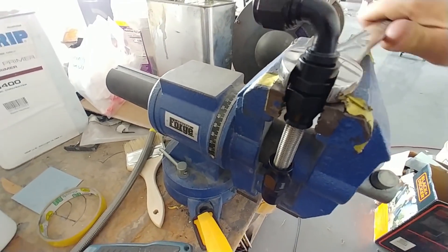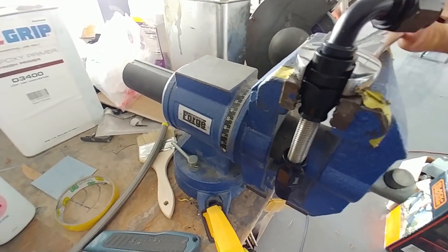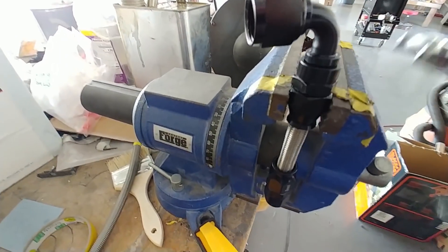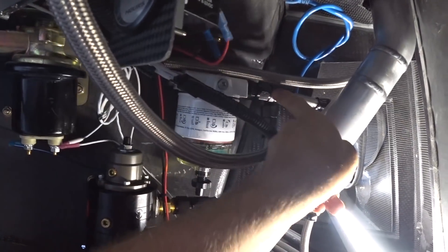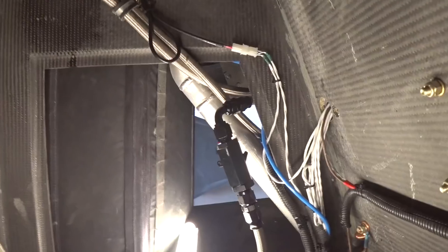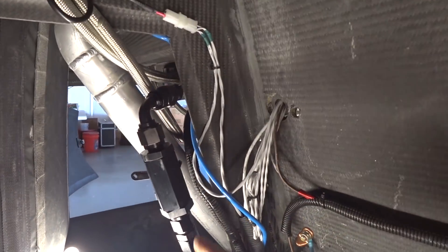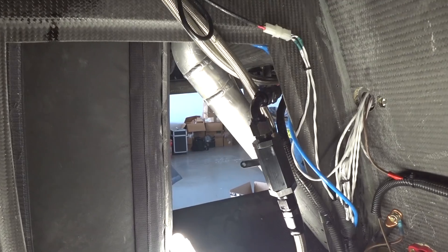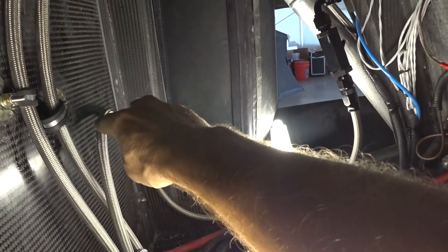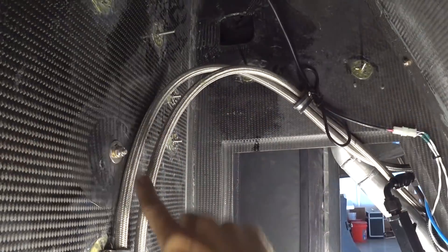I was a bit disappointed, so I had to take that one back and order the correct one, which is going to be a bit longer. While doing all that, I created a little short splice and put this extra valve in place so I can now turn off the fuel when I want to work on things — safety-wise it's a manually operated valve so it won't accidentally cut off fuel. I've also kept this loop lower now because I was worried that if the loop went up too high it might create an air bubble, so the highest point is now about the midpoint of the tank.